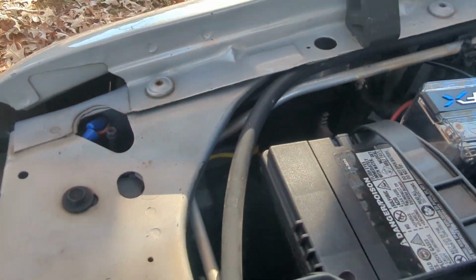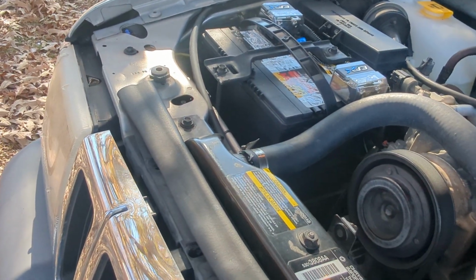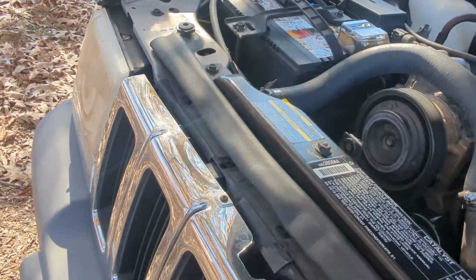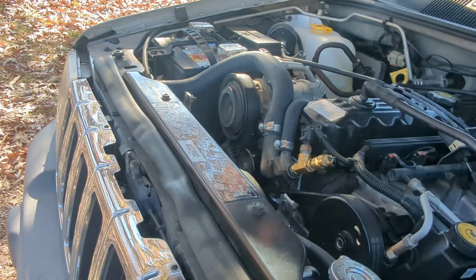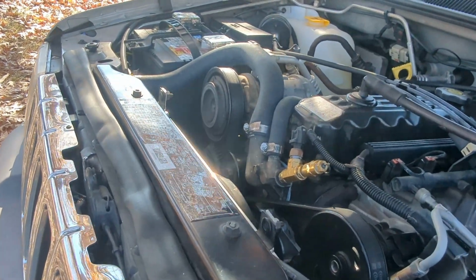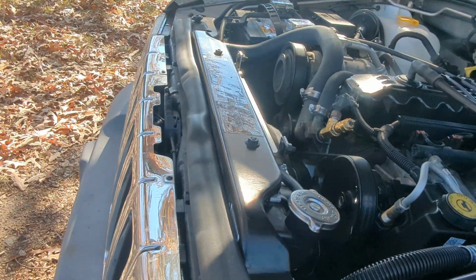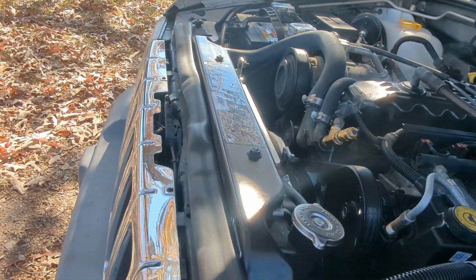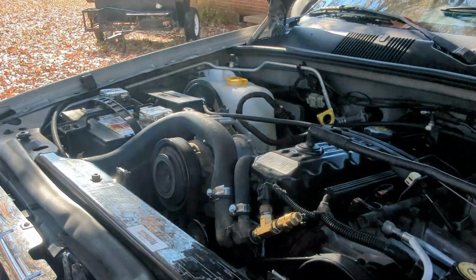You can see it a little bit. I like that it actually has a soft start on it. Whatever speed or temperature you set it at, it brings the fan on at 60%. And then I believe for the next couple of degrees, it just increases the fan by like 10% each time until it gets to its maximum speed. Seems to work great. I like that soft start on it. It takes that real hit off the alternator from these fans. Makes a huge difference, especially for people already pushing the system with electronic upgrades, from stereos or anything.